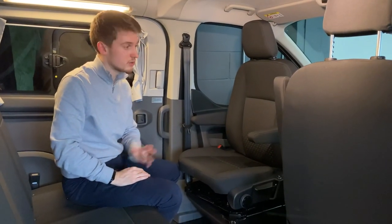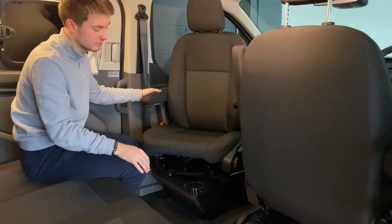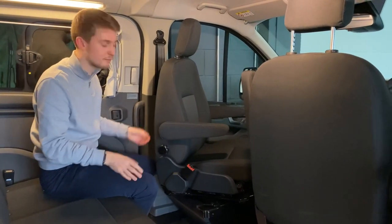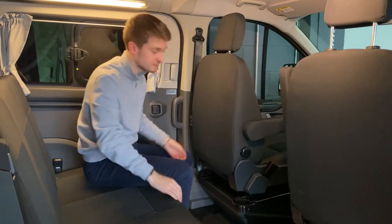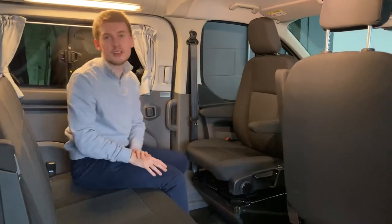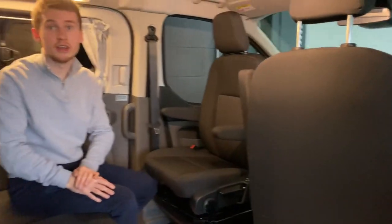Aside from the other seating, you get two swivelable captain's chairs, rotated using this little lever just down here — separate from the lever that moves the chairs forward and backwards. Make sure the backrest is upright, otherwise it won't turn properly. Twist all the way around until it locks in place, and to swivel back, pull that lever again and it will swivel back to where it needs to be. You've also got two adjustable armrests and a little knob on the other side of the seat for lumbar support.